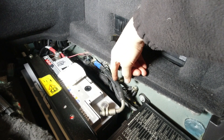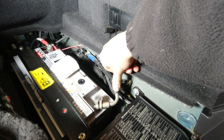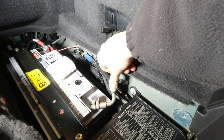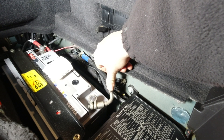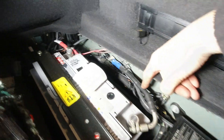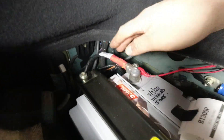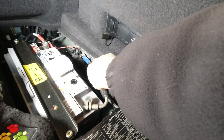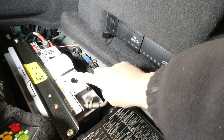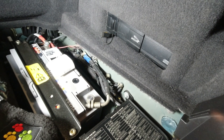On mine you can't shake it because this is a really substantial piece of kit. This was fitted to the very first cars launched like mine, and I believe it's a hangover from the late XJS models. Later cars will have a braided cable much like the positive - quite flexible, but the quality is not that great. When you shake it, if your resistance value moves dramatically, you've got issues.